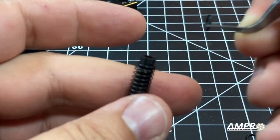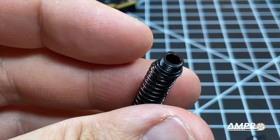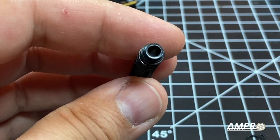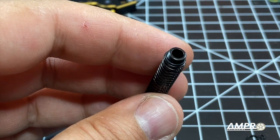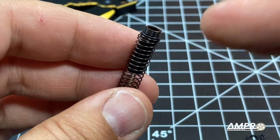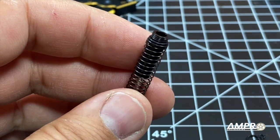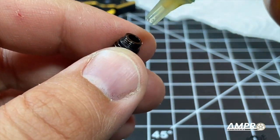We're almost done. So with this larger O-ring, you'll wrap it around the top, okay? Seats very nicely. I'm going to put some oil in here. I have found, in my experience, the more oil you put into this thing here, at least these smaller shocks, the less effective they are. What I mean is that the car is usually quite a lot lighter, so it doesn't have the weight to initially get that shock shaft to flow through the oil, and it makes them very stiff. And I put about maybe 2 or 3 drops in here.